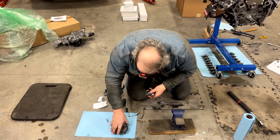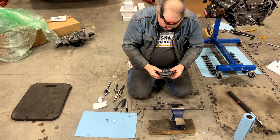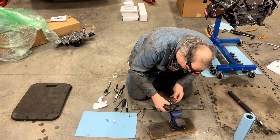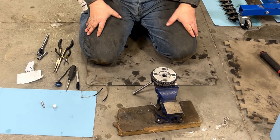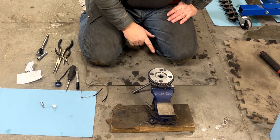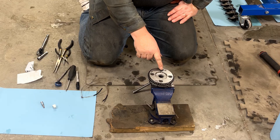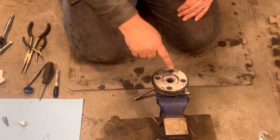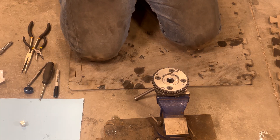Let's start by putting the cam holder tool, the phaser holder tool, in the back. That actually goes through all the pieces here, and then we'll try and clamp this into the vise. Okay, so that's clamped into the vise. I'm going to put my safety glasses on, and we'll start by taking out the short ones, and then this long one, and then we'll back this off enough to try and rotate this cover. They're all labeled: short, short, long, long — and this is the one we only want to just back off. We'll start by just loosening them.